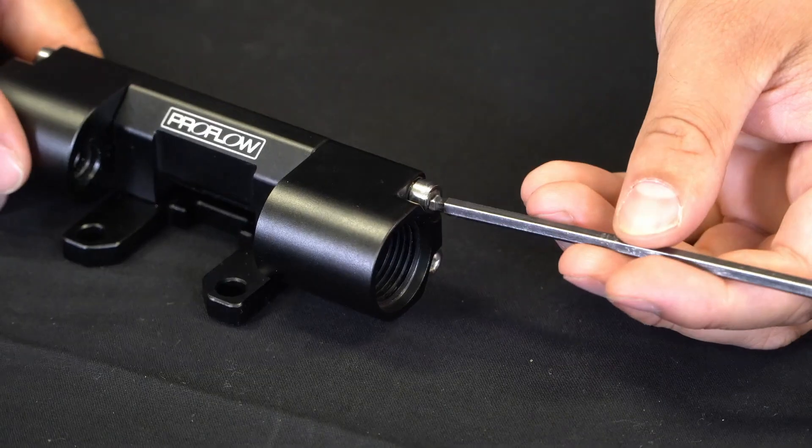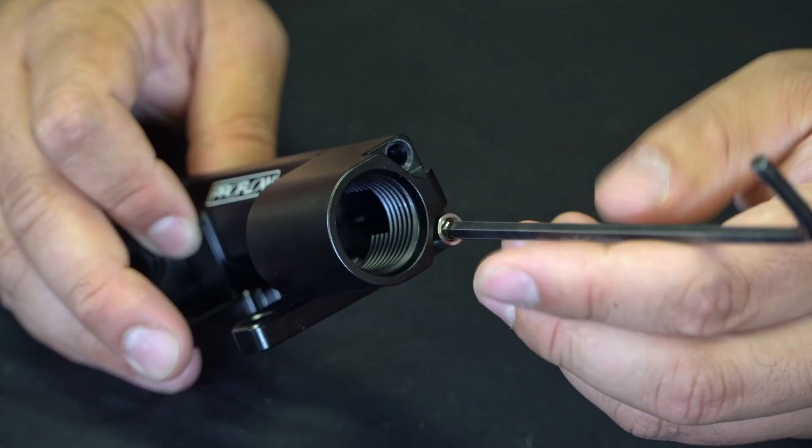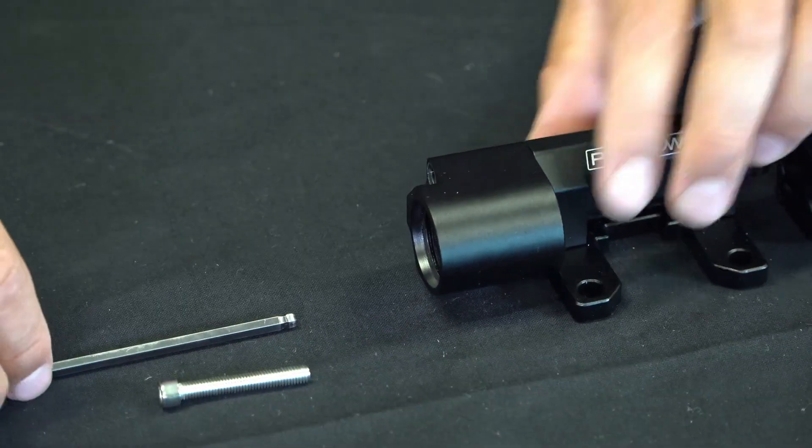The adapter is compatible with a number of GM FlexSensors and installing them is as easy as undoing these two bolts, sliding in the sensor with the o-rings, reassemble and done. No need for complex and expensive Y-blocks anymore.